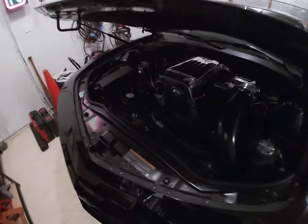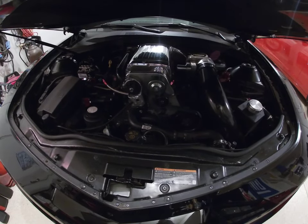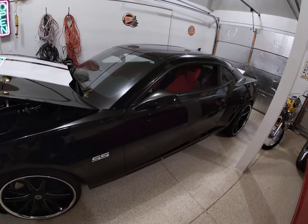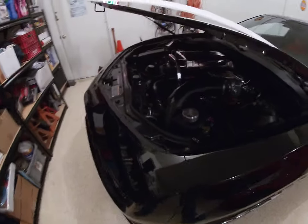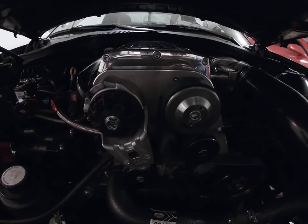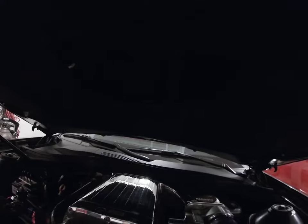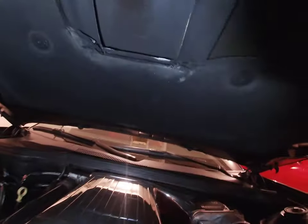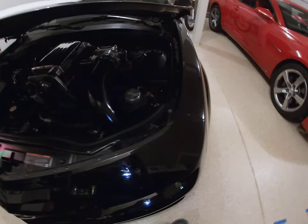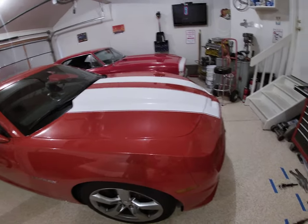What's going to happen when you're jacking that transmission up and lowering it is the engine is going to shift a little bit too. I had a polyurethane insert I tried to put into an existing trans mount, and to my surprise it actually raised the transmission slightly. The consequence is that the front of my engine tilted forward about an eighth to a quarter inch, and as it did, my clearance on the hood changed — it actually caused a ding on the top side of my hood. It had to go to PDR to get it out because we have a custom paint job I don't want to damage.